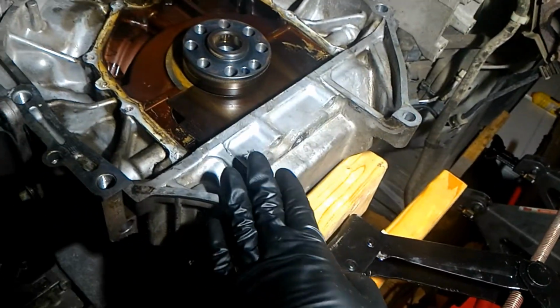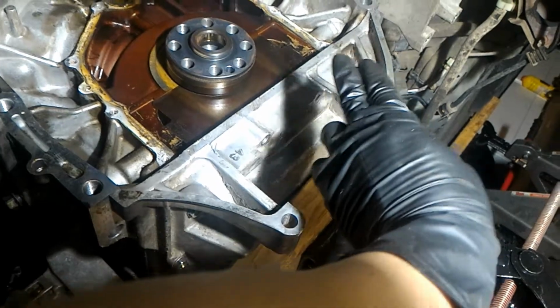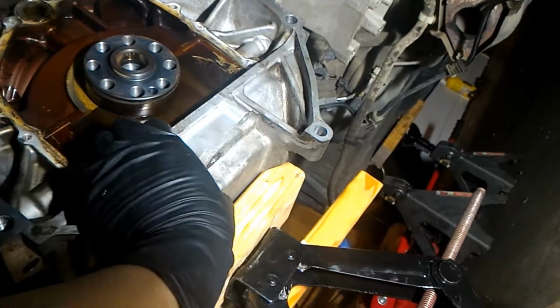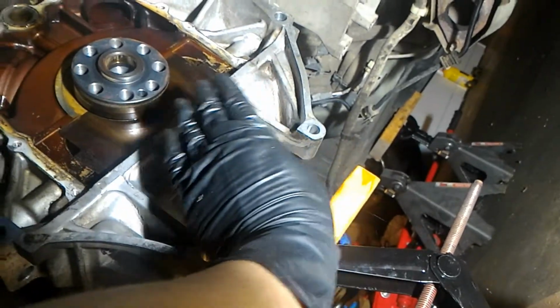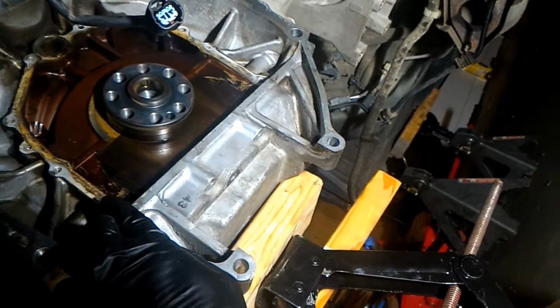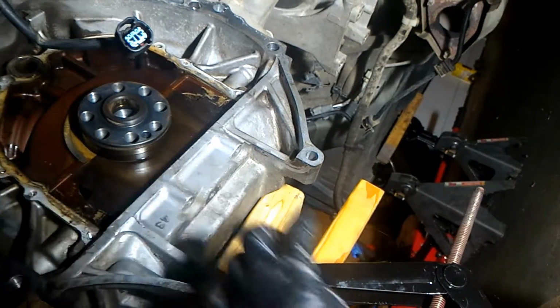And this is the oil pan, so the bottom of that plate mates with the oil pan. So make sure, because this is open right here at the bottom, put a plastic garbage bag or grocery bag here. So when you use your razor blade to scrape all this off, the stuff doesn't fall inside to the oil pan.